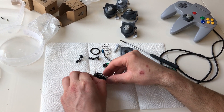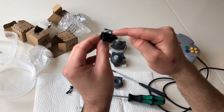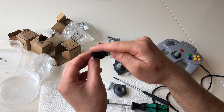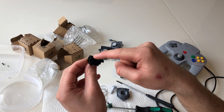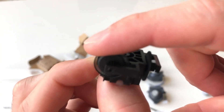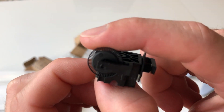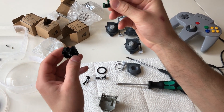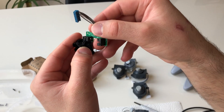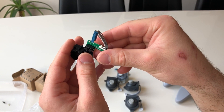On this part there are small wheels with holes in them. As you move the joystick back and forward, the optical sensor tracks how much you turn — how many degrees — to the left or to the right, and it can even detect which direction you're turning. The light and optical receiver are placed around this wheel, and each time the light is blocked and then becomes visible again, it sends a signal to the computer.